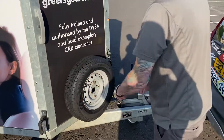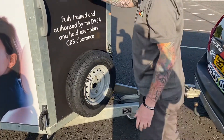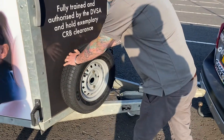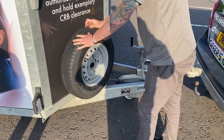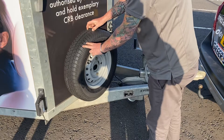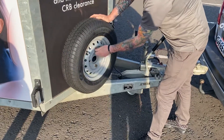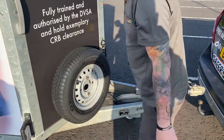Check that the panel is intact — you don't need to go rivet by rivet, just check there are no cracks and that the handle is secure. Then come to the spare tire. Physically touch it and check it's properly and tightly secured onto the trailer, with sufficient tread all the way around the wheel — minimum 1.6 millimeters across the central three-quarter breadth of the tire and around the entire circumference. There must not be any cuts, bulges, or tears on the wall. Check the valve cap is on and the wheel nuts are secure.